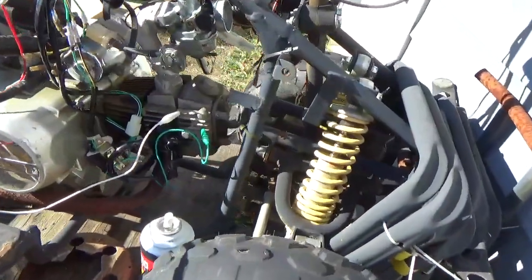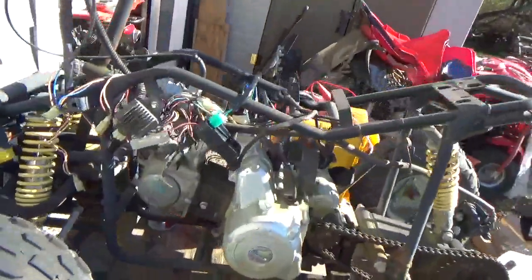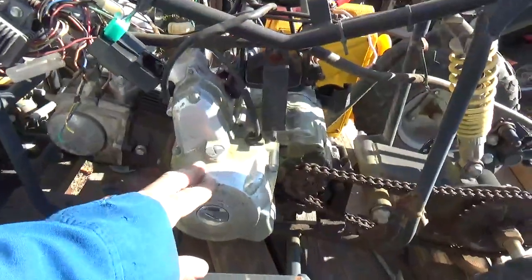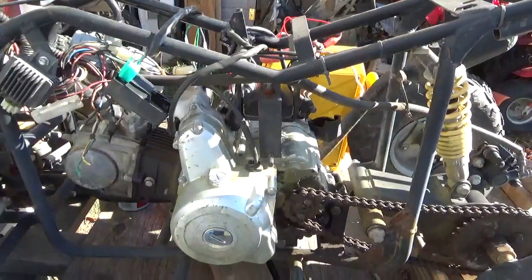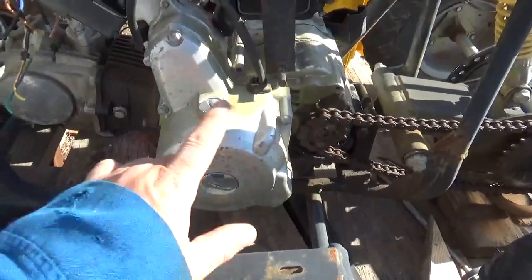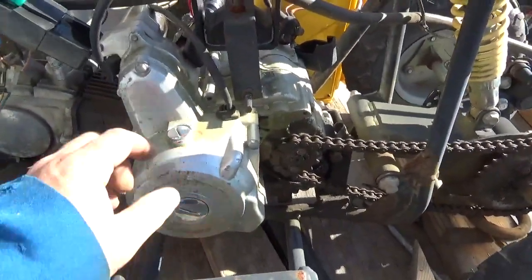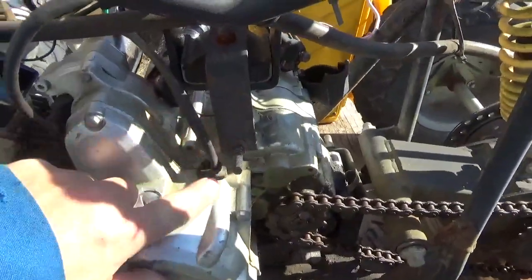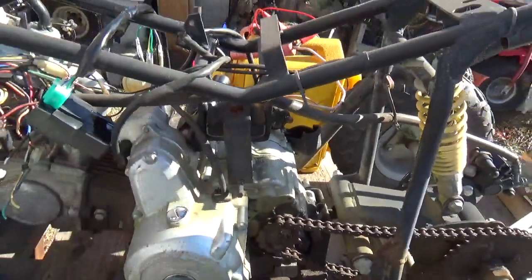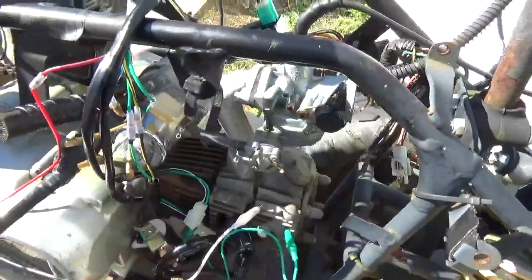Let me show you the part you're actually going to have to think about. Having a CDI kit is great, but having a functional one is better. If you don't have a way of hooking it to the engine, the CDI has no idea when to spark — it won't spark because it doesn't have a pulse generator. Beneath here is your flywheel, and between the caps you can set the timing. This wire comes from your stator and pulse generator, and they assigned wire colors to match everything on the pit bike harness.